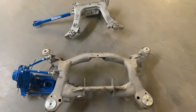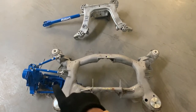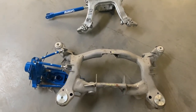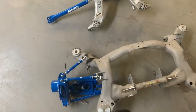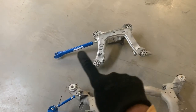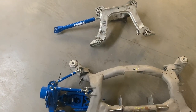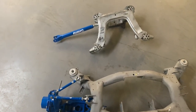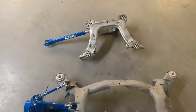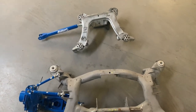The subframe over here is an E90 M3 subframe. As you can see, the control arms — there's a bunch of them and they're all quite short, especially the ones on top; the one where the spring sits is a little longer. The E36 and E46 have only two control arms and they're quite tall. In the picture it maybe doesn't show the difference clearly, but in real life it's a huge difference. That's one of the key features that makes that car perform so well, because if you have very long control arms it means you're not changing the geometry much under compression.